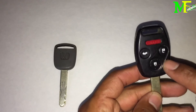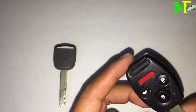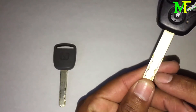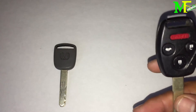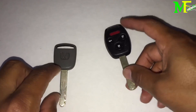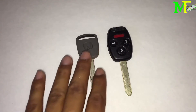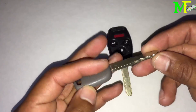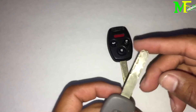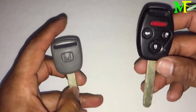What you can do is go to eBay and look for your key with the key fob — the electronics and transponder inside. I'll try to post a link or another video on how to find it in the description. It'll arrive blank of course — eBay has the option to check if it fits your car. Once it arrives, you have a blank key. Take both the blank key and your valet key to the locksmith and have him cut the valet key into a master key and cut the blank key as well.